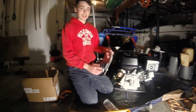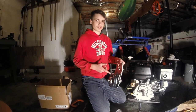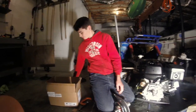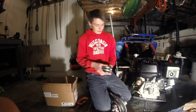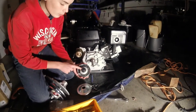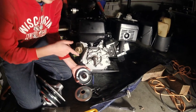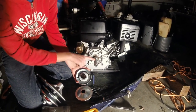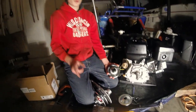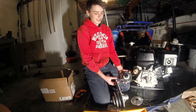This kit I got off eBay is a 30 series 1-inch torque converter. The driver pulley mounts on the crankshaft of the engine, and this hole right there is 1 inch and this crankshaft is 1 inch. If you have a smaller Predator engine like the 212s, they have a 3/4-inch shaft, so make sure you get a 3/4-inch. They also make a larger 40 series, but that's about $400 — this one was about $60, so this is an off-brand version.